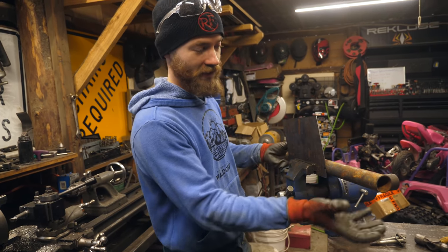This is the crank pulley — the crank-end timing belt pulley with the teeth on it for the trigger to read for the bottom end, the crank position sensor. This should be a GTE oil pump, so it's an upgraded oil pump and it also allows for the fitment of the crank position sensor. All of that means this 2JZ is going to be a lot more tunable, a lot more reliable, and a lot more better. Very high quality stuff — awesome setup.